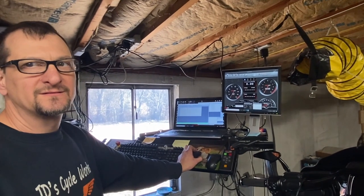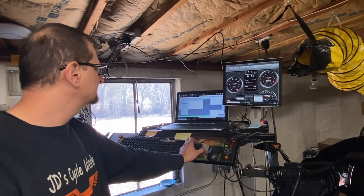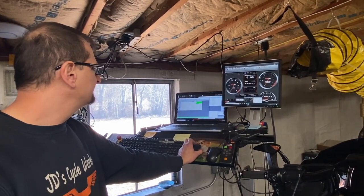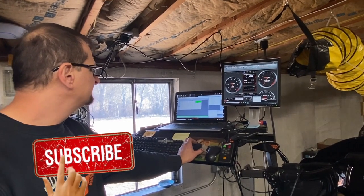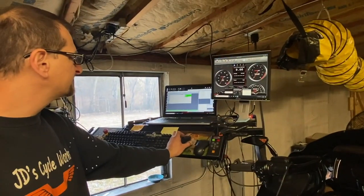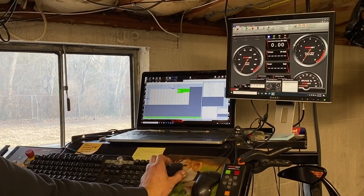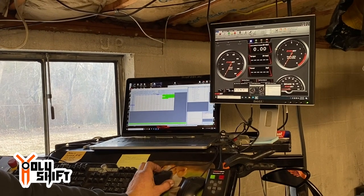By the way, are there any parameters for changing the spark delivery timing? Yep, that's these tables. That's all timing. And you can see there, it's right from down at idle. This is your starting area. This is your mid-range cruising. This is your high-load area. Like when we're doing a dyno run, you're going to be running down this column at 100 kPa or 100%, depending on how your table's set up, and right down to whatever RPM I shut it off.